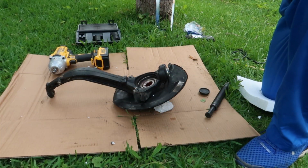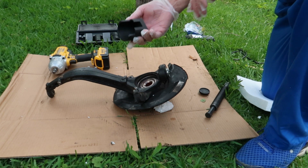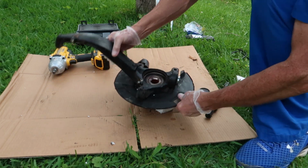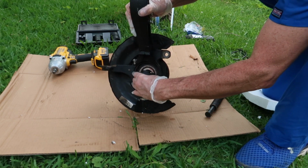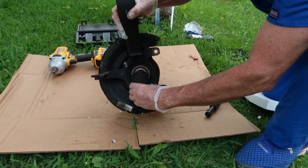Okay, now that we've got that cut off, it'll be so much easier to press out. You're definitely going to need this Honda specific spacer with the flush backside that fits right into the knuckle, and you're not going to be able to do it without it. You can also purchase one on Amazon. They're pretty cheap. I'll leave a link below.